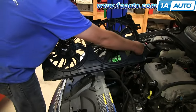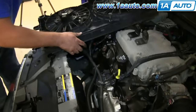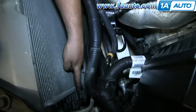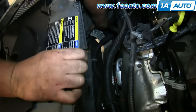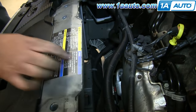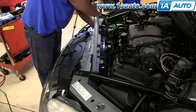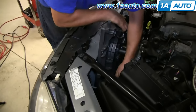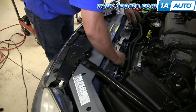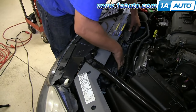When you replace the radiator fan, there are two tabs on each side of the radiator — more on the lower side. They go into slots on the radiator itself. Put your new fan down in and work the passenger side down under the radiator hose first. Make sure nothing binds up or gets caught in there, then lift it up and down into those slots.